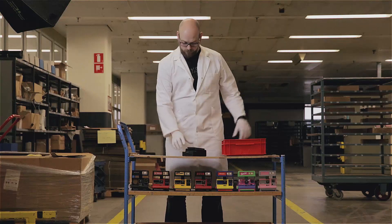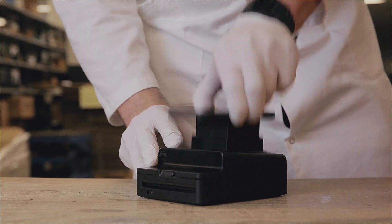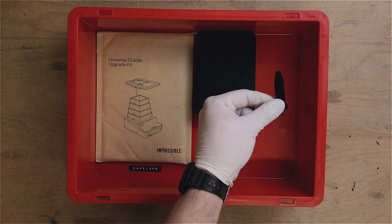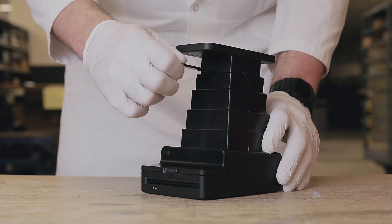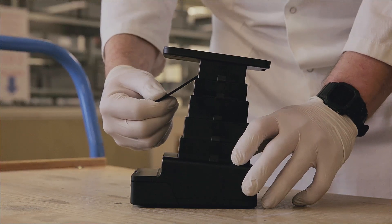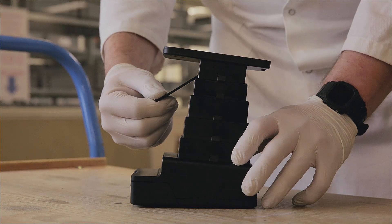To begin, fully extend the tower on the Instant Lab. Now locate the Cradle key and insert it into the key slot. Push it into the seam firmly. Use the key as a lever to release the front of the cradle.